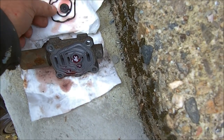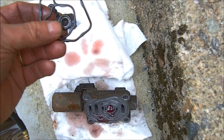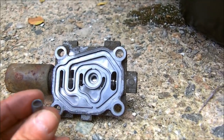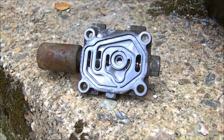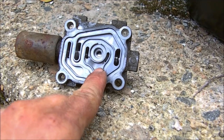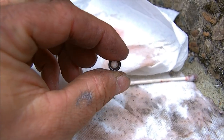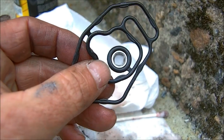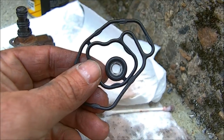Here's the deal with this piece: there's a gasket, and I just pulled the gasket out and that screen came out with it. There's also a little tube with a screen in it, which corresponds to the spot on the transmission where this mounts. You want to check that because that little screen can get clogged up as well. Mine actually was pretty clear, which was amazing given how clogged this one was. I've cleaned this one out now — just sprayed it with carb cleaner and dabbed it with a Q-tip — and that looks good to go.